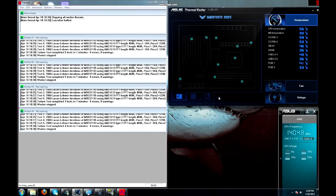After a 10-minute burn, it's reached a temperature of 60 degrees Celsius and it's dropping rapidly. It is using undervolting because the turbo technology is enabled and it undervolts even on high performance mode using Windows-based settings. We're going to restart, and on the overclocked setting we're going to perform the same Prime95 test — we'll skip over the StarCraft II — and see how it does.